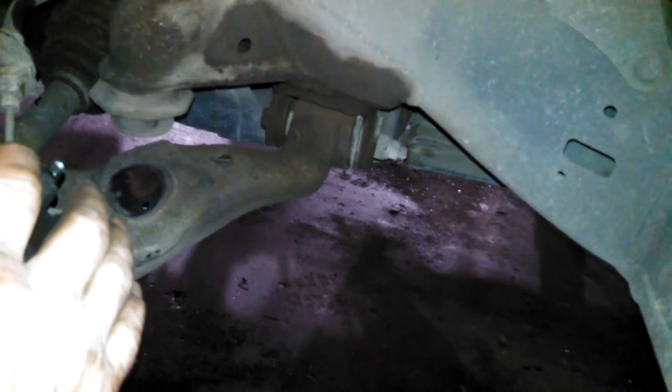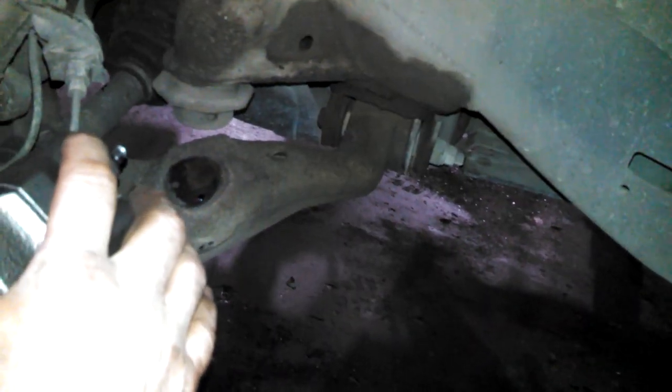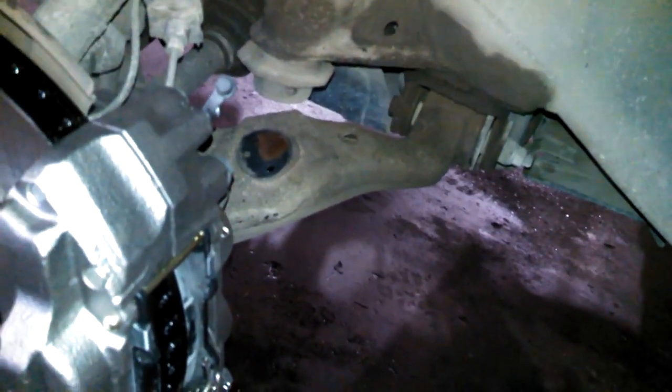We'll open this up - we're looking for solid fluid to come out of here. Once we see solid fluid flowing once or twice it's probably going to be good, and then we'll tighten this up permanently. And that will be bleeding your front brakes, in a nutshell.